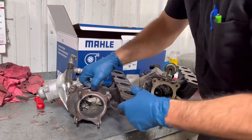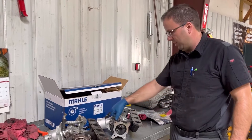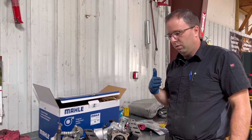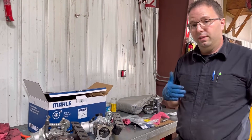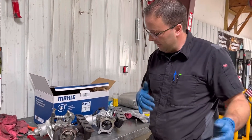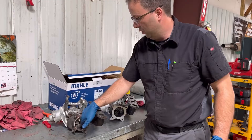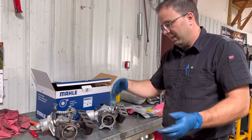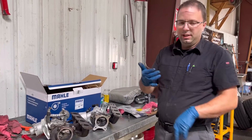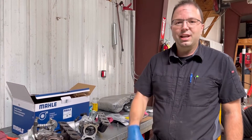What I've learned is that the best way to properly diagnose this failure is to get approval from the client to remove the catalytic converter, which mounts right here. Once that exhaust is moved out of the way, the wastegate lever is very accessible and easy to see, allowing a confirmed diagnosis. The downside is we may have to put it back together and bring it back in for the repair. Anyway, I hope this has helped — 2-liter Audi P0299 under-boost condition. Thank you for watching.